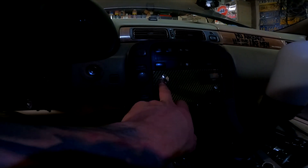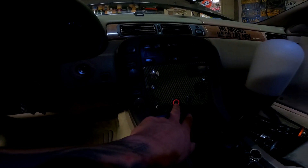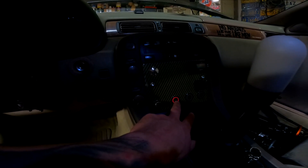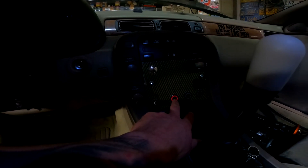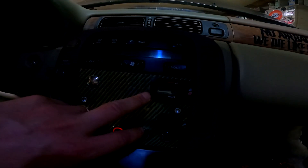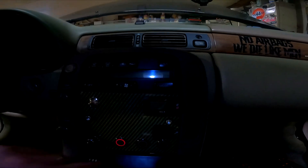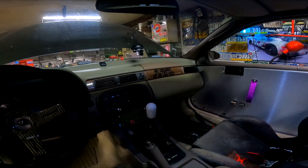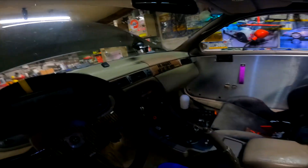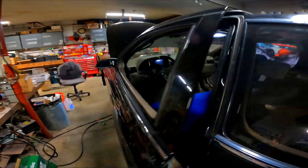I'm not going to do you there yet. Rolling anti-lag. I wired the digital dash to an actual button because it is right about a 10 second startup time, so I'd like to turn that on first before I crank. I wired up a digital fuel level gauge and then a couple other little things here. Finally got the ECU mounted in the glove box and wiring is pretty much finished up.